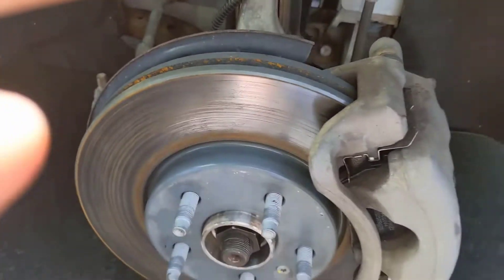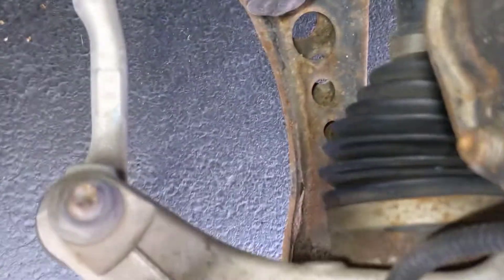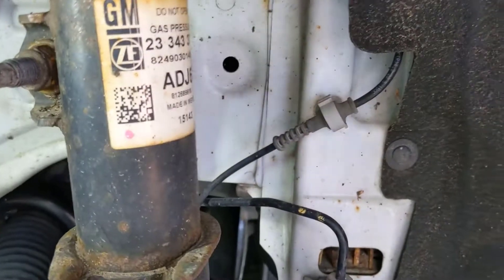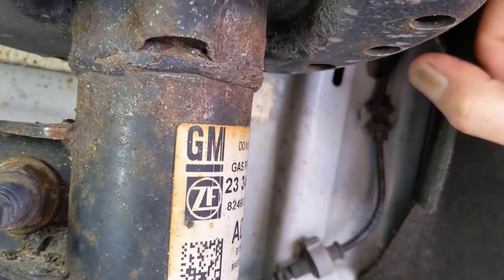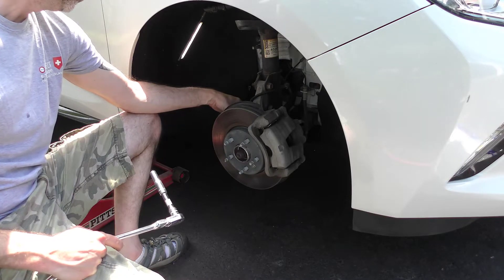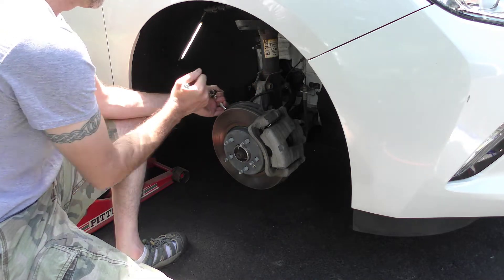I didn't put it on jack stands because this will be a pretty quick fix. The ABS sensor, if you watched my last video, is actually inside. We replaced this hub and also did a full brake job in the last video, but I don't have to take all that apart again to get to this hub because the sensor is accessible from the back side here. Here's the bolt and here's the cabling coming up into here. We have to unclip it, and there are also clips to pull from behind this shielding. It's a 10mm bolt, so I've got a socket with an extension and a 10mm, and I'm going to go ahead and take off that bolt and pull the sensor out.